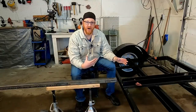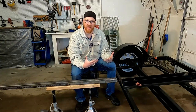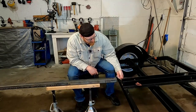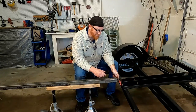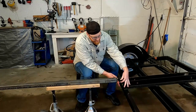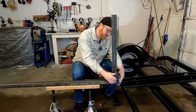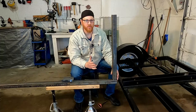I didn't really want to modify the trailer, but for ease of navigating it into the hitch properly I'd like to go in and notch this out — make a C cut on both sides — and then mount a pin here so those C holes can slip right on the pin. I'm looking at creating a mast here, and I'll weld this together to make a tight joint.